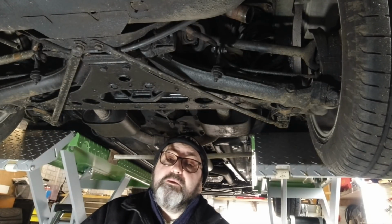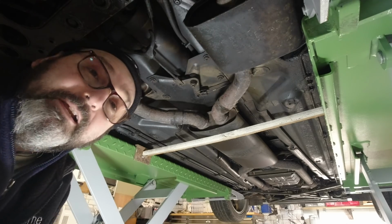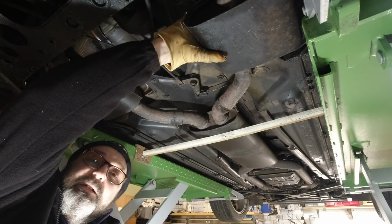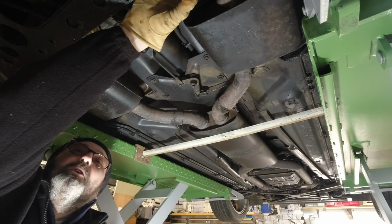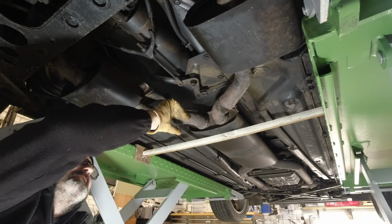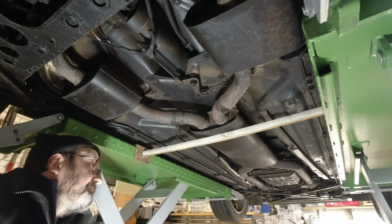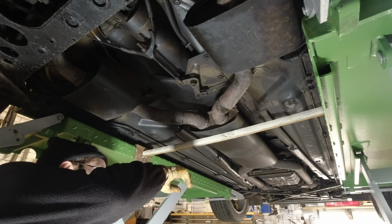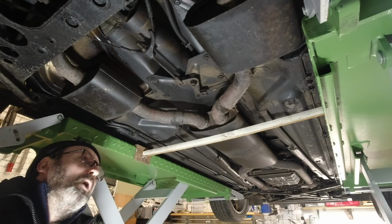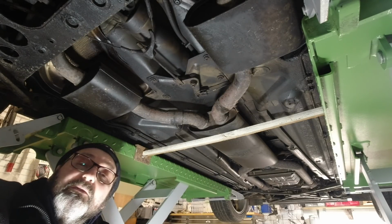But today, as I say, it's the overaxle boxes and pipes that are coming off. First little thing to share, and it's a real first world problem that I'm very pleased to have: if you're going to be taking off the resonators before the axle, and the overaxle pipes, and you've already got the tailpipes off, then you're going to be disconnecting these brackets that go onto the big centre box. Now the big centre box is quite heavy. It's linked to 2 pipes, which in turn go to the catalytic converters, which are vertical on an XK8. And there is actually nothing holding up the system from this point until you get to the catalytic converters and the manifolds and all that sort of thing.